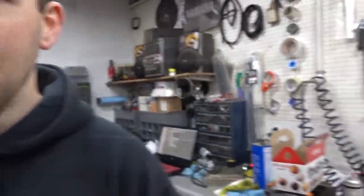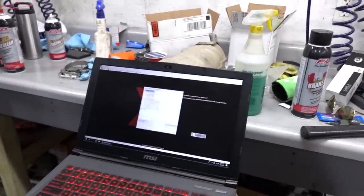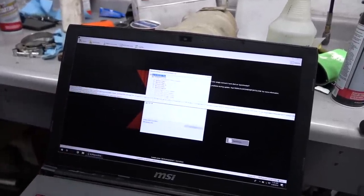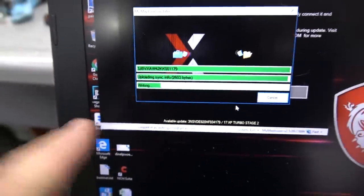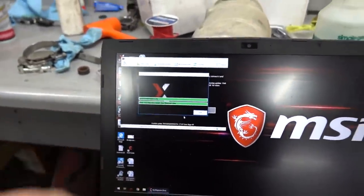Hit 'Map Tuner X,' then pick Rick's VIN — select the 1179 which is at the bottom. From here we go to 'Request Tunes' — we talked to our friends at Evo to request the 3RWI tune. Hit 'Submit Request' and we got a direct line to Evo. It said it was syncing the 3RWI, so we requested the tune via the software. This thing should be ready to roll — Rick, take it back out and unhook it.